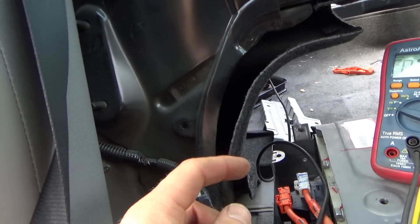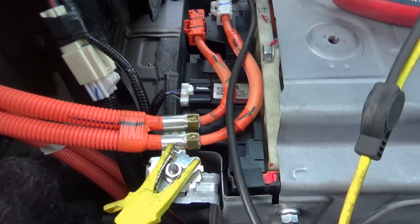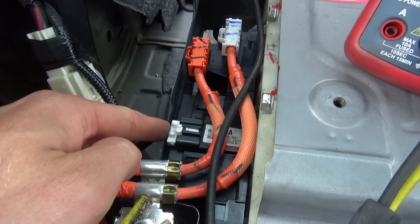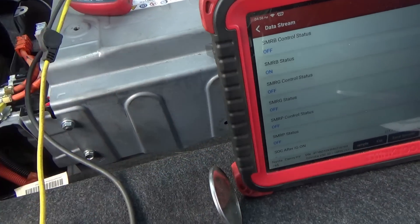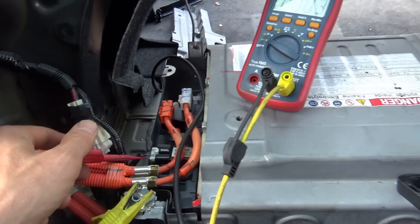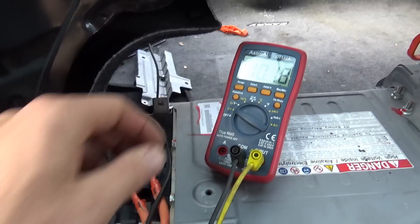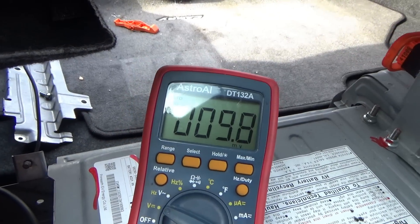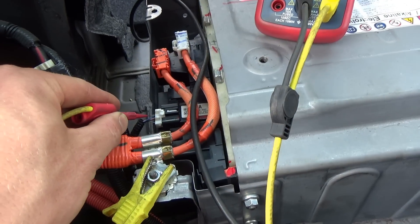Here is the hybrid battery. On the side there's a little cover held down by one screw out of three — someone's already been here. It's an auction car, so you're going to find surprises. We'll keep going with the diagnosis. This little four-pin connector has the blue, pink, black, and gray wires — that's where we want to do our checks. Taking a voltmeter: gray wire reads 10.1 volts, so that agrees — status is on. Pink wire is 0.9 millivolts, off — that agrees. Blue wire is 51 millivolts, also off — that agrees.